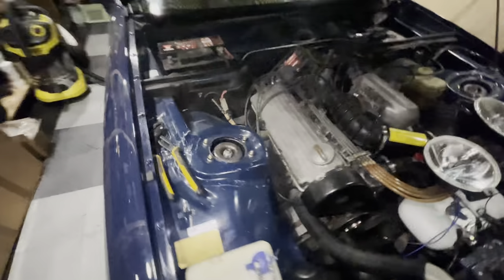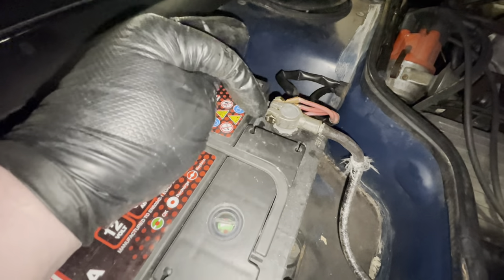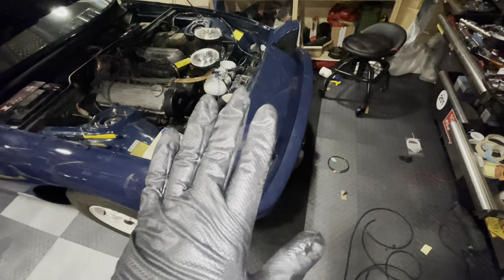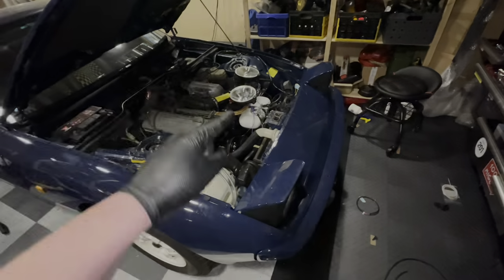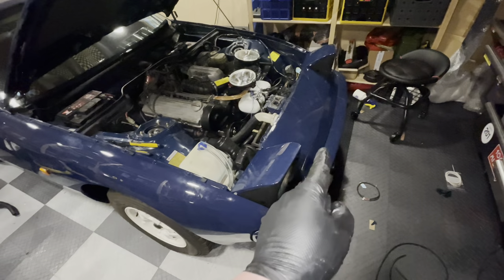I've connected my wiring harness to the battery and swapped the terminals from this side to that side because that works a little bit better. So what I've got to do now is remove this front bumper again, which means disconnecting the lights on both sides as well, and push the wiring harness so it gets to that area of the car. Let's get started on that.